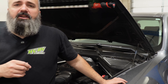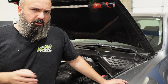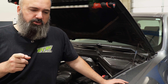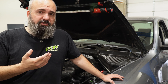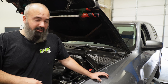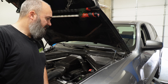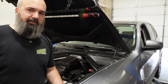The problem is the BMW instructions call for pulling the engine support arms off of both sides of the block, which are held on with aluminum bolts that I don't have. So what I'm going to try to do today is do the motor mounts without pulling those arms off, which means I'm going to have to drop the subframe again. If you're doing it by the BMW instructions, you have to pull the intake manifold off to get the driver's side support arm off. Let's see if we can get this done without pulling the engine arms off and having to order more aluminum bolts.